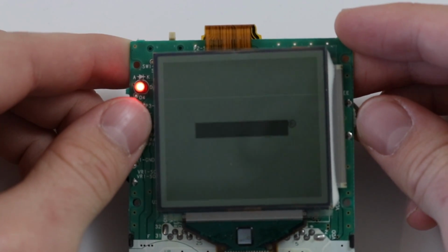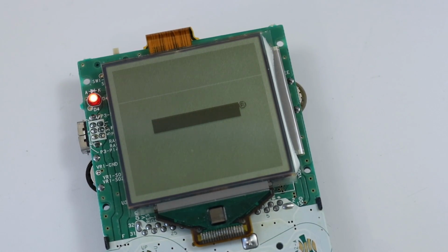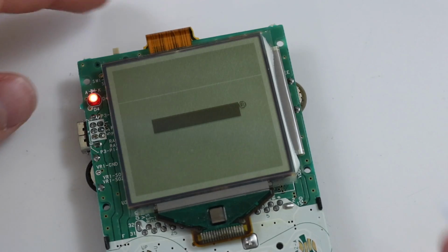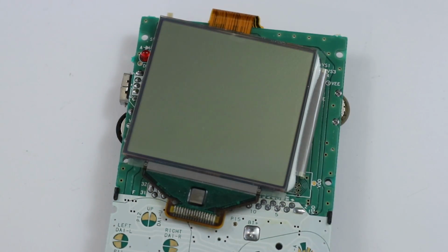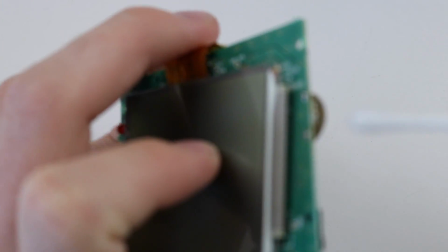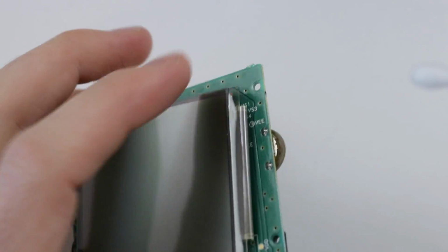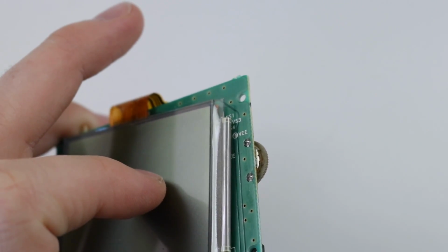The contrast wheel's a little bit flickery. I'll actually show you how to fix that. Obviously, when I do my little cutscenes on my Let's Refurb, you don't get to see me going into detail of what I'm doing in some instances. But same with the power switch: if you get your Q-tip, drop some isopropyl alcohol on it, and just drop it on the inside of the switch, the potentiometer rather.